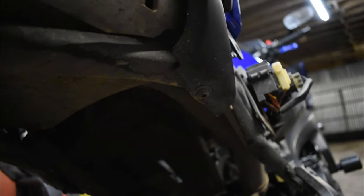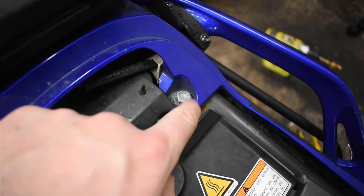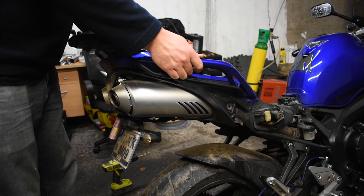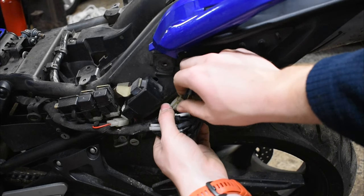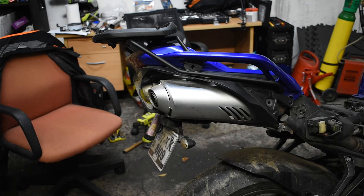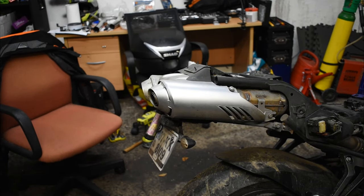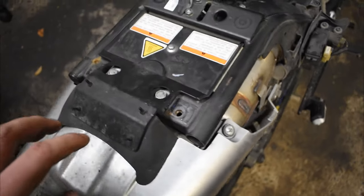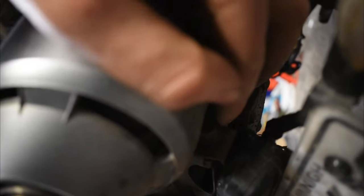There are two lower trim bolts — I had to drill one out, but they should come out fairly easily, and you do get a replacement frame piece with the kit anyway. Remove the two outer bolts shown here, then pull away the whole rear handle assembly. I forgot to unplug the rear brake light, so make sure you do that, then lift the whole unit up and pull it away.